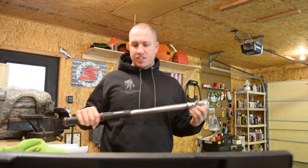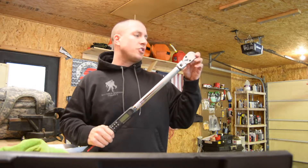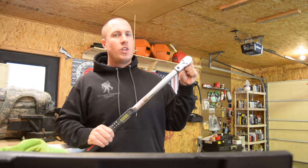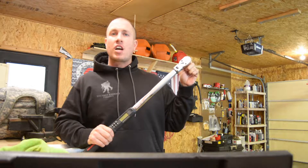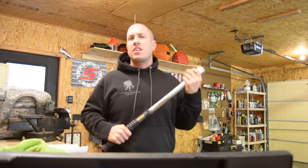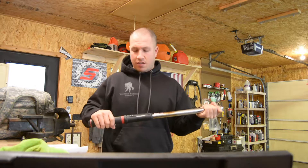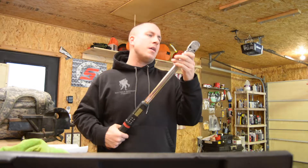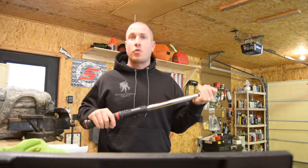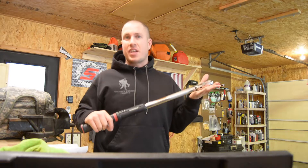This is an 80-tooth torque wrench, so it's really nice to have the 80 teeth in there — really fine adjustment. You don't really have to worry about lockup. I think the pawl on this, inside the ratchet head, has like six or seven teeth. I haven't opened this one up, but I'm pretty sure it has six or seven teeth on it. So you don't really have to worry about breaking that pawl at all.